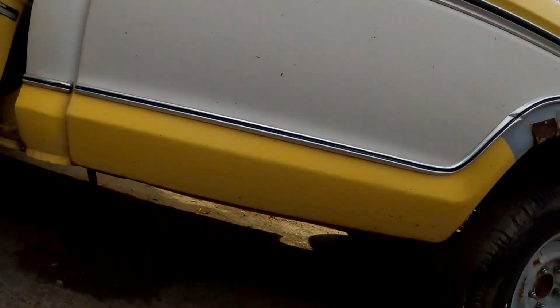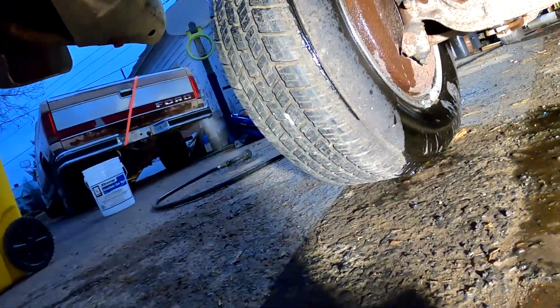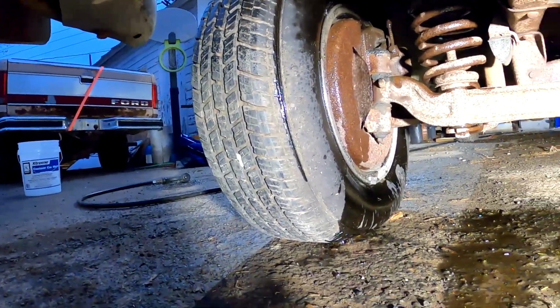But anyway, our brake pedal, let's see. Our brake pedal should have pushed some of that fluid through, and we should be seeing a pretty big brake leak somewhere for that thing to have no fluid in it. It's starting to get dark out right now, but I don't see anything. I do see that I'm on my front tires. Now it's a 79. This thing came standard with discs. And I think we found our leak.